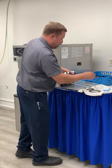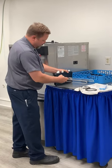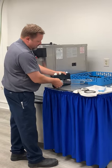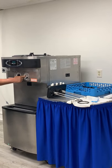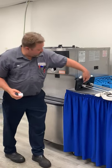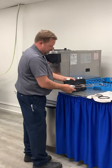Now putting the rest of the door back together. We're going to start with our bushings. The bushing has a wider end on one end and a skinnier area on the other — we always want to make sure the wider end is up against the door. These sit inside the beater and allow this piece to wear down instead of wearing down your door. Always make sure the flat side is up against the door itself.